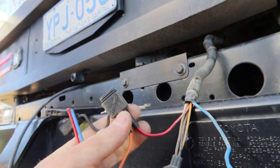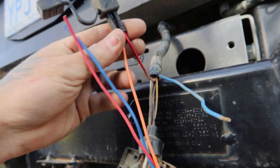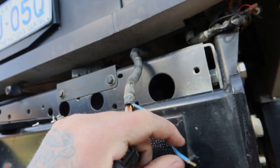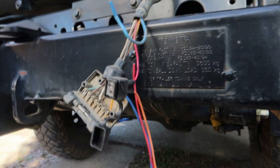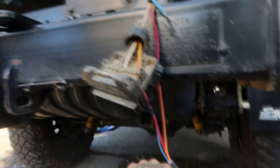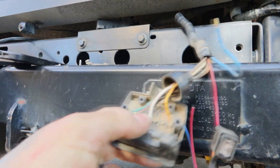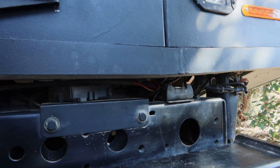We've got the RedArc loom running all the way through. It comes with instructions telling you which way to go: take the red and blue out — red goes to a join clip — and tape off the factory wiring harness blue wire, just tuck it out of the way. Put the new red and blue to the trailer plugs; the instructions and the trailer plug tell you which is which. Toyota actually fits their tow plug underneath — I knocked mine off somehow, so I've pulled it up and mounted it on top of the tow bar so it's out of the weather and won't get hit again.